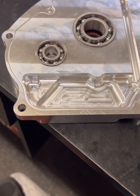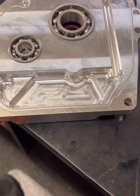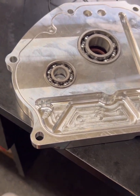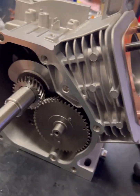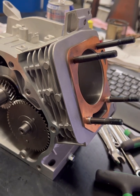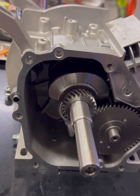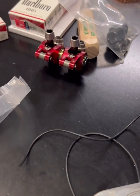I'm not going to use the O-ring because I don't have any shims on this crank. Without the O-ring, I put the cover on and I don't get any end play, so I'm going to use a gasket and we'll see if she seals. I've got a pretty much deck height set up, a 32 thou copper head gasket, and the head stud kit from either OMB or EC Carburetors. I'll get that side cover buttoned on and we're going to be checking the push rods I just bought to see if they're the correct length to use with these EC rev rockers.